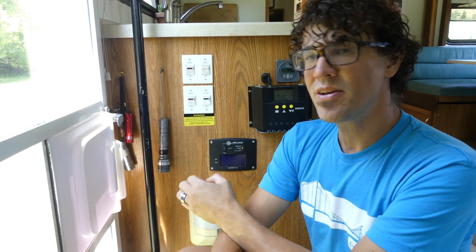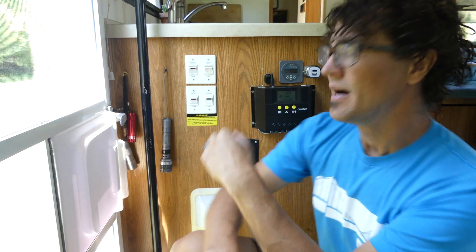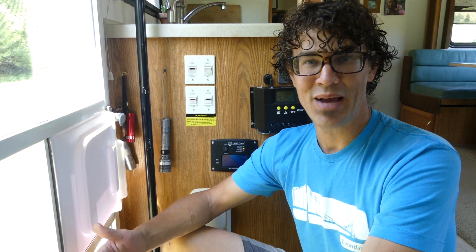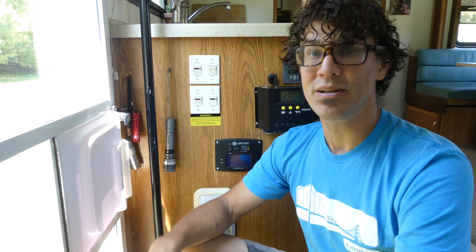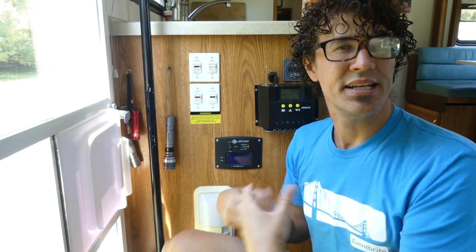But that can also be a con — all that power comes at a cost. Simply turning on the inverter with our shore power plugged in uses up 100 watts of electricity, even if we don't power anything from it. So we only turn it on when we're actually using it. Another con is it's extremely heavy. I thought it probably weighed 100 pounds. That is definitely a drawback when you're limited in the amount of things that you can carry. It's also very large and takes up a lot of space in the bay. And it's kind of noisy — just this little hum that we can hear inside when it's running.